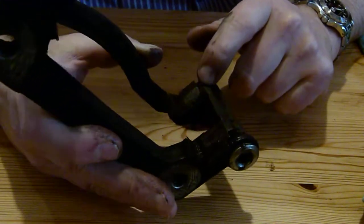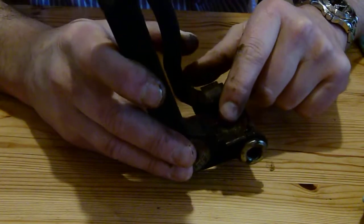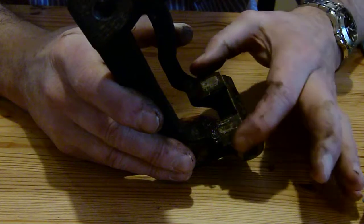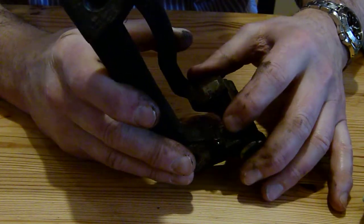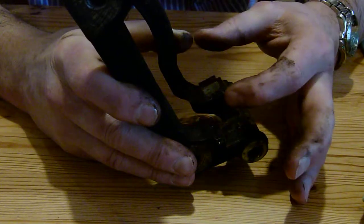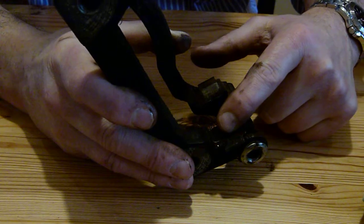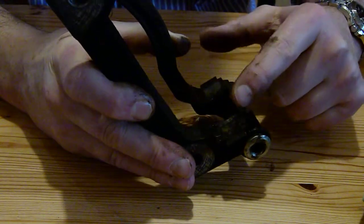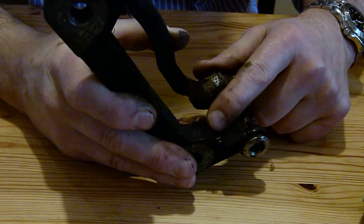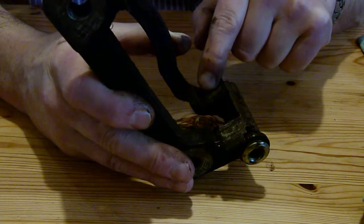The final area requiring a different lubricant — different from the caliper pin and different from the brake pad — is the caliper brake clip where the brake pads sit, sometimes called shims. Over time, because of the lack of movement in a caliper, the pads will corrode, especially if there is salt on the road. If the pads are corroded in the clips, the brake has to work harder to squeeze the pads against the disc, as they must overcome this resistance. If you are knocking out your brake pads with a hammer each time you change them, it means your pads are corroded into the clips and your brakes are working sub-optimally, because some of the power is being used to force the pads against this resistance.